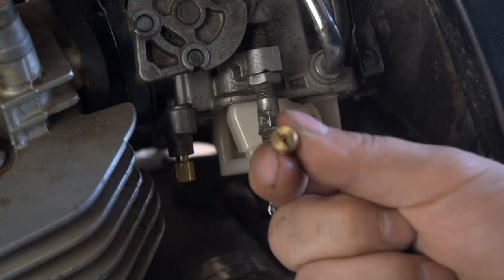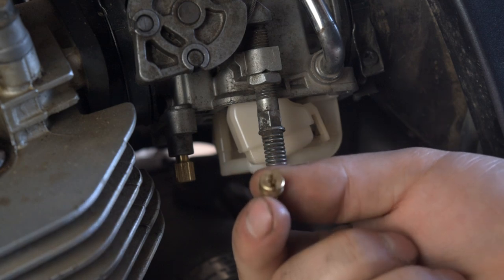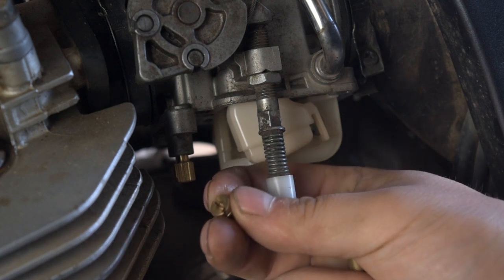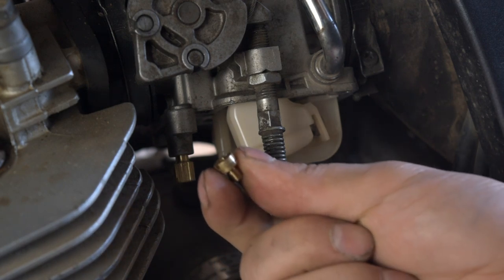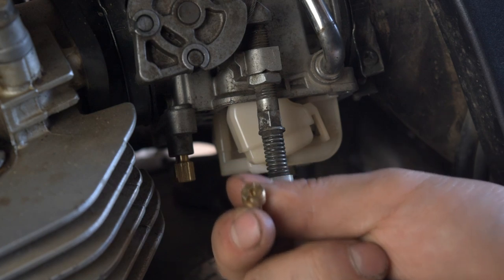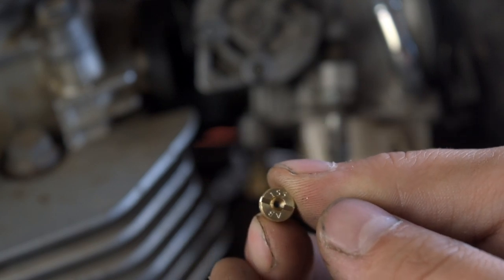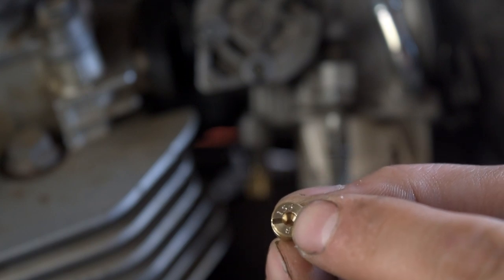This 140 is going back in dad's bike because dad's has been re-jetted, and it was re-jetted before he got it. The other guy had a pipe but put the stock pipe back on when he sold it, and dad doesn't want to invest in another pipe. So what we're going to do is seal up his air box so it's like factory, then put back this stock 140 jet and set his bike back to factory spec. That's fine for him - remember he's coming up from the XR 250, so the DR is already crazy powerful for him. The 155 jet has a bigger hole than a 150, then a 145, and so on - the bike runs a 140 from factory.